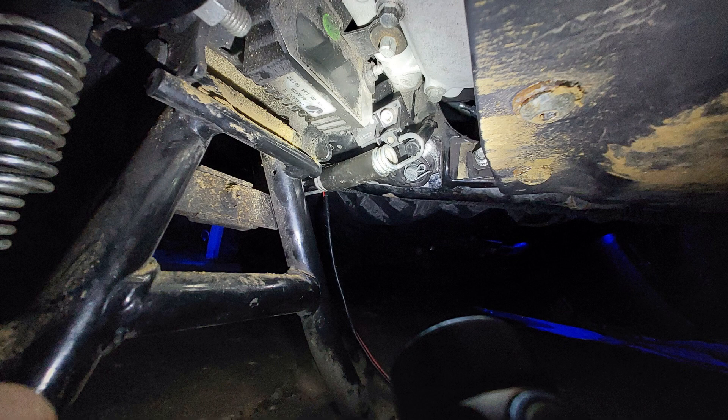This picture was sent to me kindly by Philip, and it shows the rectifier regulator in its stock position under the bike. You can see from that it's covered in filth, the fins will probably get blocked very shortly, and there's a shiny bit on the bitumen-type black gunge on the back of the rectifier. I believe this is due to heat.